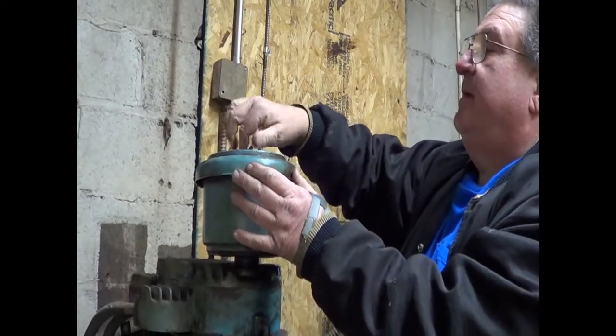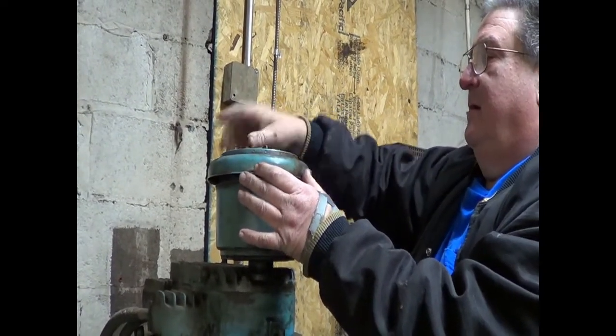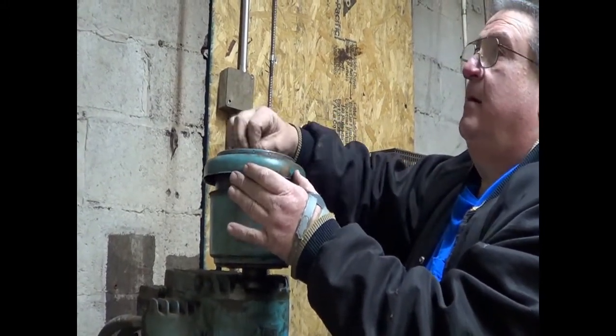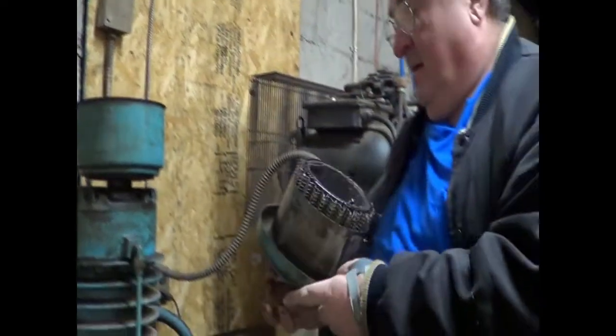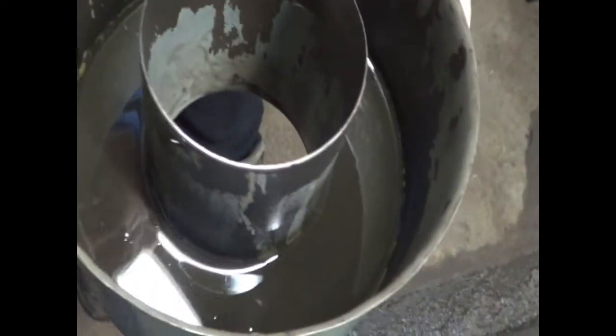There's a wingnut on top. That's going to be messy. There's our oil filter — it's actually oil that runs through a maze of mesh, and it's an oil bath air filter. We're going to take it out of the truck, we're going to dump this out, and we're going to clean up the can.